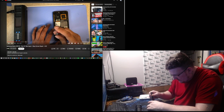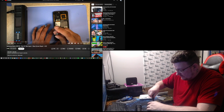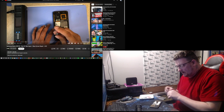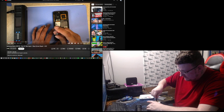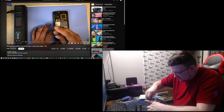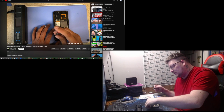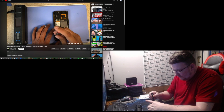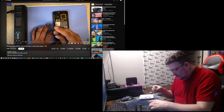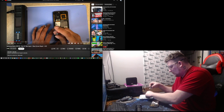But if y'all have a Samsung A32 5G, not 4G, 5G, then if your screen's broke, go to Amazon. They got them, the whole shebang, for $38. But, like I said, you have to have the A326U and not the A326B. U is for United States version. So if you live in the United States and get one with a B, then it will not work with your United States version A32 5G. These screens ain't compatible with the 4G version.